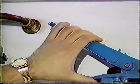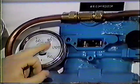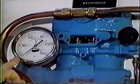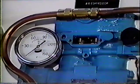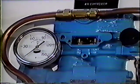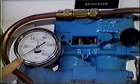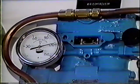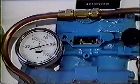We make a few stops, we drop our pressure down. Watching this gauge, when we went down 20 PSI, we dropped our unloader pressure to zero. The pressure now is building back in the system. We watch this gauge, our unloaders are down. We get to about 120 pounds, we should begin to see the needle move up. And now we're back to our unloaded mode. Our unloaders are back up again.